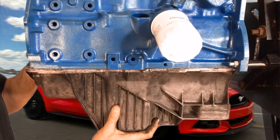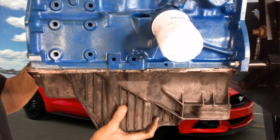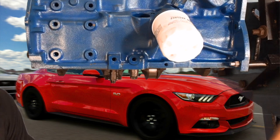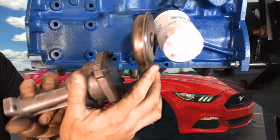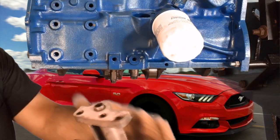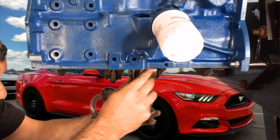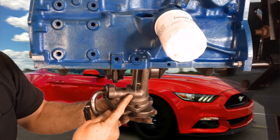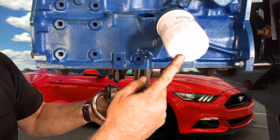All these blindingly fast-moving metal parts need constant oil. The oil is picked up from the oil pan by the oil pump. This is the pickup — what's known as the pickup — that sits in the bottom of the oil pan. This pump pulls the oil up out of the oil pan, pumps it through this filter, and then all throughout the engine.